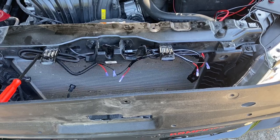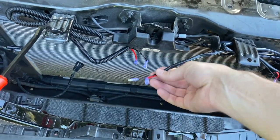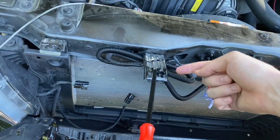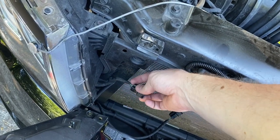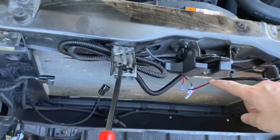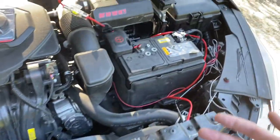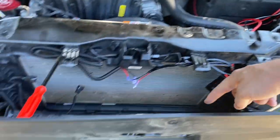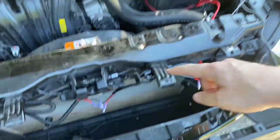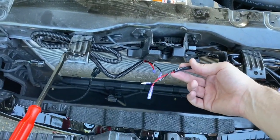Now that we've got the wires in the approximate positions we need to take care of this wire right here. This is what's considered the trigger wire. It's going to snake up through here and across — this top wire is what I'm going to be using. I'll lop this off and use some extra length of wire and some connectors to bridge that gap. It's called the trigger wire because it connects the button on your steering wheel through the fuse box all the way down to the main horns. If you connected these horns directly to power and ground and then to the battery, the horns would just constantly go off because there's no actual trigger mechanism.